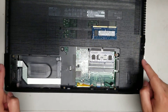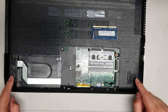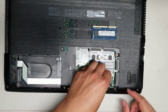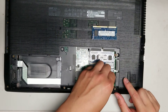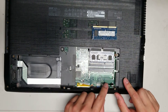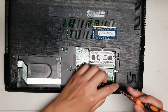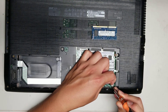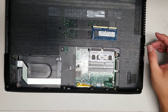One other thing: if you're going to remove this panel, you want to remove this cable here — it holds the speakers, which are actually mounted into the case. To do that, grab the two wings. If you can't, you could pull from the wire but be careful not to pull too hard — wiggle it and keep pulling. Since the wires are really thin, you can try using a screwdriver to get the other side, then use your fingernail on the other end and wiggle it out. Or you can lift the cover slightly first and then do that.